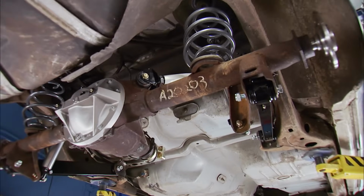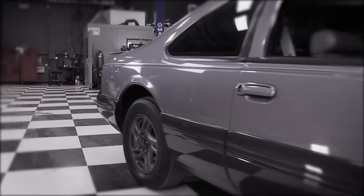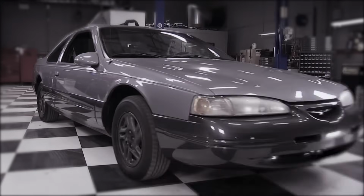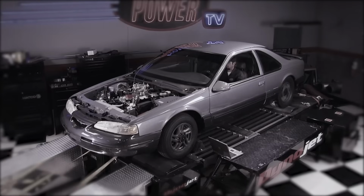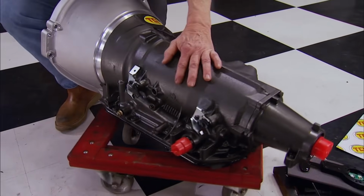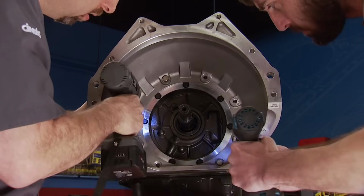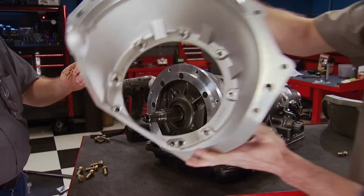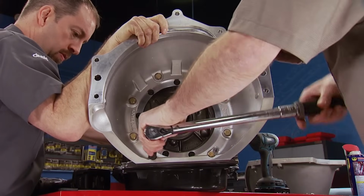Now that the weight is out back, we're going to get the engine and transmission ready to go in. Five years ago, we built a '97 Thunderbird dubbed Deep Sleep. It had a 6-speed auto behind a 600 horsepower small block Ford. Well, we kept the trans around and it's going in, gray hair, white knuckle. In order to do so, this bell housing with the Ford pattern must go, and a GM pattern goes in its place. It's made by Reed and is SFI approved and shatterproof.